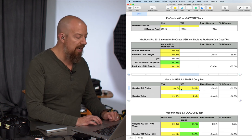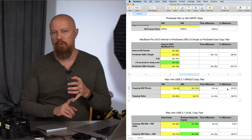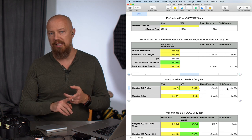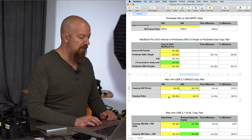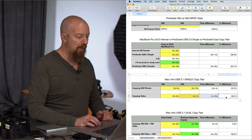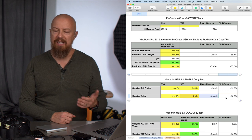Even just V60 to V90 here is a difference of 4 seconds or 33% — quite the difference. This tells you that if you are in a mission-critical type of work where you have to get pictures off the card into the computer as fast as possible — Olympic photographers come to mind — every second counts, and the V90s will make a difference for still photographers. Copying the video files, from the V60 it took 4 minutes and 7 seconds; the V90 took 2 minutes and 32 seconds — a minute 35 faster, or a 38.5% difference. Let's just call it a third less time to copy off the V90 than the V60.